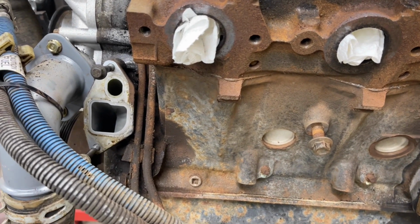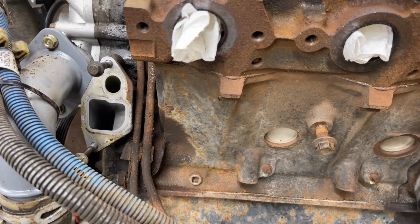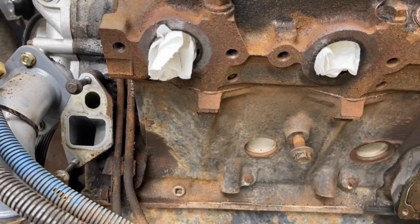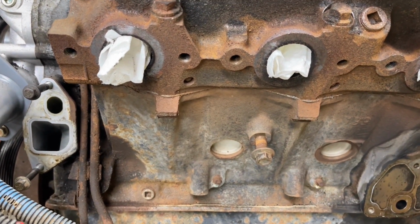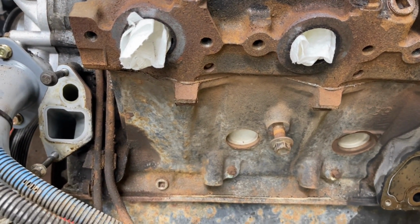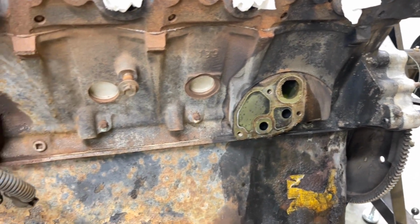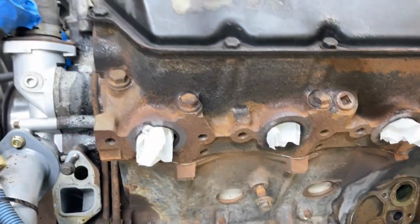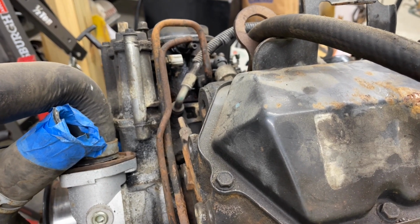When? It's up to the engine because it's all done by pressures and everything like that. To feed the injectors, which is its main component, it likes to pull oil direct from the pan and can actually bypass the oil cooler, which has the oil filter on it. So you can get unfiltered oil into your high pressure oil pump, and I highly suggest putting the screen in.